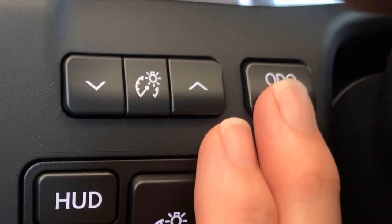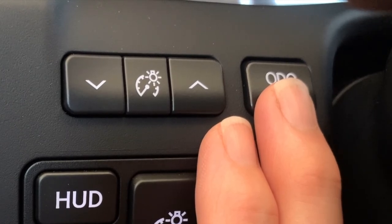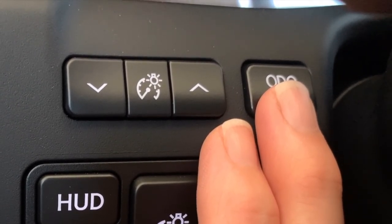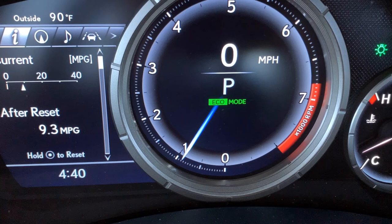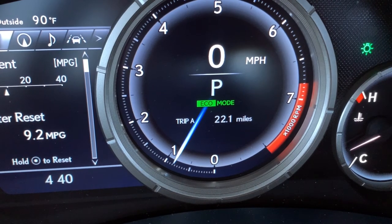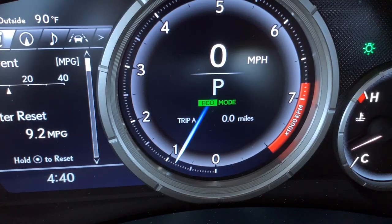Keep in mind that you're going to service your vehicle every 5,000 miles, but because it uses a full synthetic oil, you only have to do an oil change every 10,000 miles. Your next screen is blank if that's your preference. To use the trip feature, simply toggle to trip A or trip B and push and hold to zero it out.